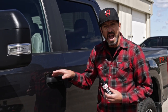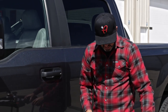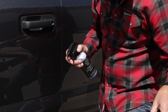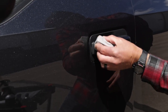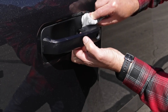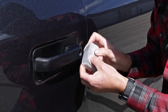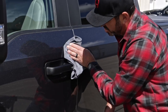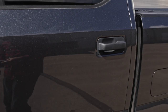In this case I haven't lost enough pigment to warrant using the black trim restorer — I don't need to put black back here, I just want to make it look rich again. The way I'm going to do that is with ceramic spray coating. I'll spray it directly into the applicator and watch how this instantly darkens the plastic, makes it look rich and new. Taking a clean towel, I just want to remove any ceramic residue from the paint. A very light wipe of the towel to level it all off and make it look literally just like new again.